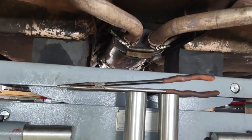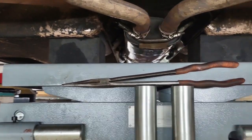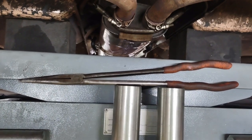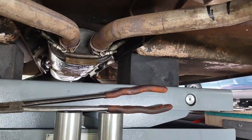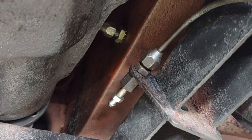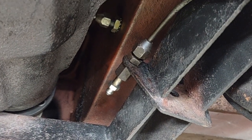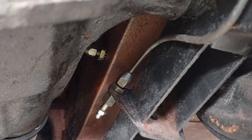It's the next day, and I just thought I would add a very last couple of thoughts I had overnight while thinking about putting in just a few tips. That's the long pair of pliers that I use to get up into a lot of areas. They do help you to hold the hose, the flex hose for the brakes, to get it into position. Let's see if I can get it up in there. Yeah, to get it through there. And on a little note on that, you've got star lock washers on both sides. Please make sure you put them in there. It really will lock it in place. It's very difficult to hold the other side of the hose in order to tighten it up, or later to loosen back up, and you really do need both star washers on either side.